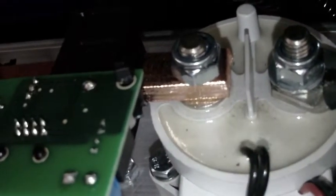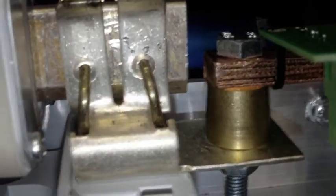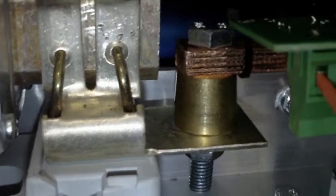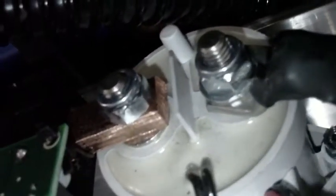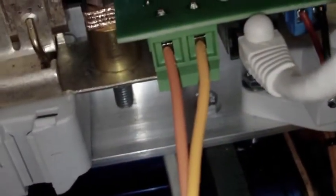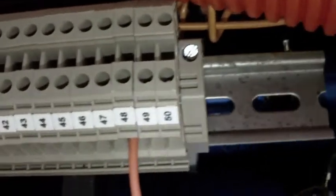This piece of copper bar goes between the rear traction contactor and the main fuse. I've done a little piece of brass stock on a steel bolt with a Nord-Lock to secure it at this end, and it's bolted straight onto the Kilovac EV200 contactor on this end. The hookups are very simple — we have the high voltage from the pack on these two terminals, picked up from the two extremes of the monitoring tabs.